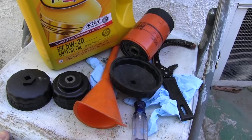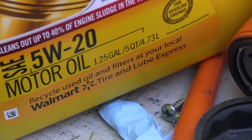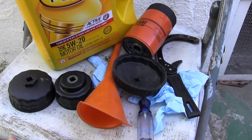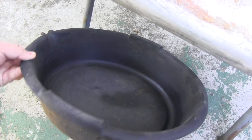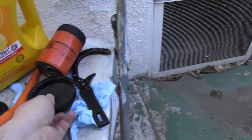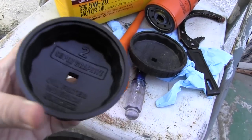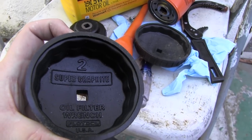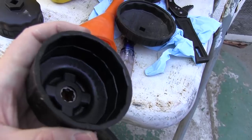There are a few basic equipment and supplies that we're going to need, such as some motor oil with the same rating. We're also going to need a funnel to pour the new oil in, an oil drain pan to collect the old oil, and a special tool to remove the oil filter. There are several different types and sizes. For my car, it uses the number 2 oil filter wrench, and this is for a Honda — it uses a smaller one.